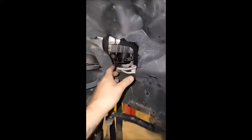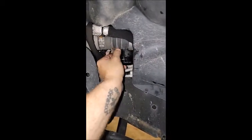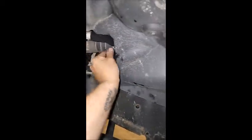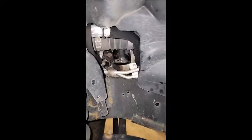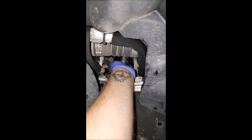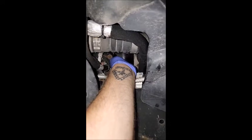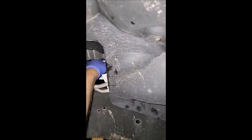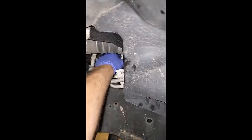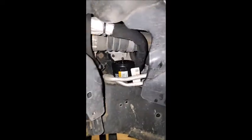You can reach in the fender well here. I'm on the passenger side of the truck in the fender well and this is just a regular strap wrench. You can loosen your filter just like that. Once we've loosened it up you can reach in and just spin it off. Now what you're gonna do is let it fall straight down, just like that — it just sits there on the crossmember.